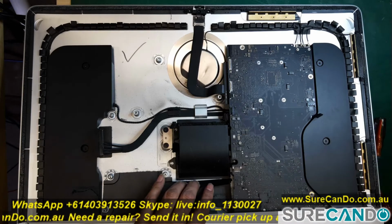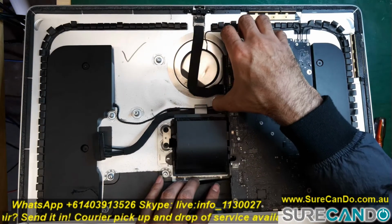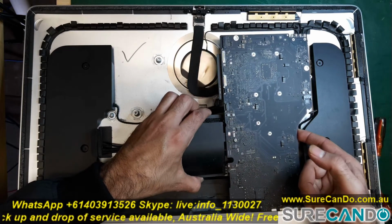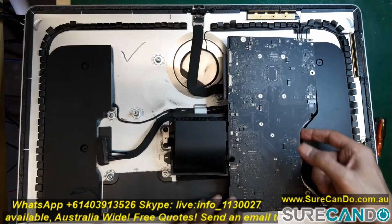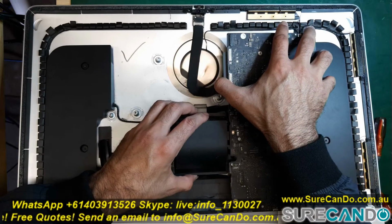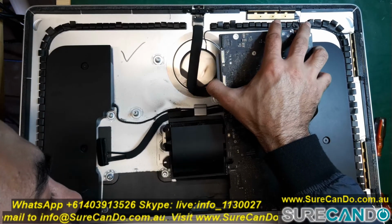One thing I do recommend is you remove the SATA cables coming from the left out of its position before you remove the motherboard, so the cables come together out with the motherboard. Not like in my case here, I left the cable still routed in that metal plate on top of the rear exhaust duct, so this made my job a little more difficult.